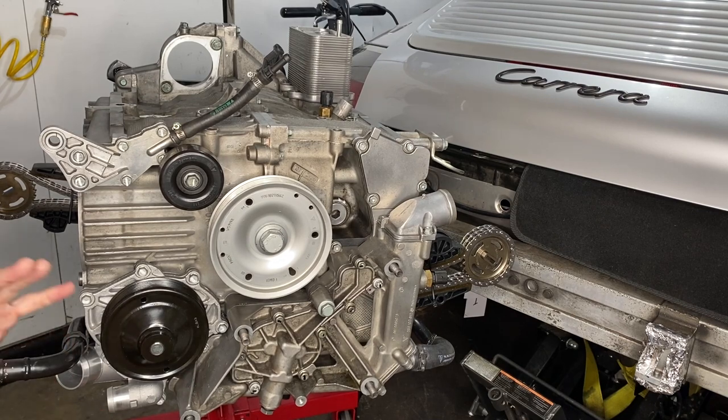And so that's it. That heat pulse has got much more time to cool down if your thermostat is open. And so therefore, the low temperature thermostat is going to be open sooner and remain open for a larger proportion of the time.